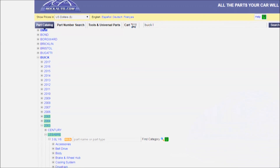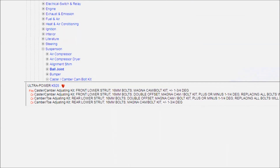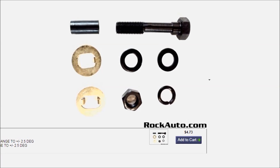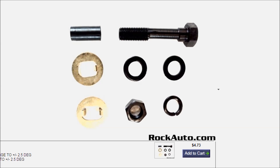Another example: new cars are built to really tight tolerances, which is great, but there's often no way to adjust the alignment — the caster, camber, and so forth. We have kits. This is for the 2003 Buick LeSabre. It's a caster camber bolt kit that bolts offset a little bit so you can have some adjustment there. The tires are going to wear regardless. I can get that kit, put it in, and I've got caster and camber back going down the road.